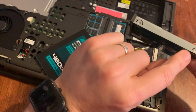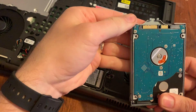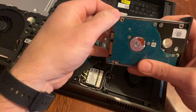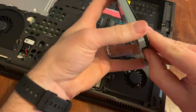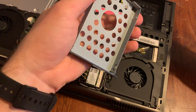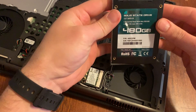What we'll need to do is take the drive out of its bracket. It's not held in by screws — there are little spring tabs with small dimples that go into the sides of the hard drive. You can kind of just peel this cover down. Try not to put force on the cover of the old drive if you want to repurpose it. Just pry gently where those tabs are, get an end started, and peel it out. This was the 500 gig drive — nothing wrong with it, we're just upgrading performance.